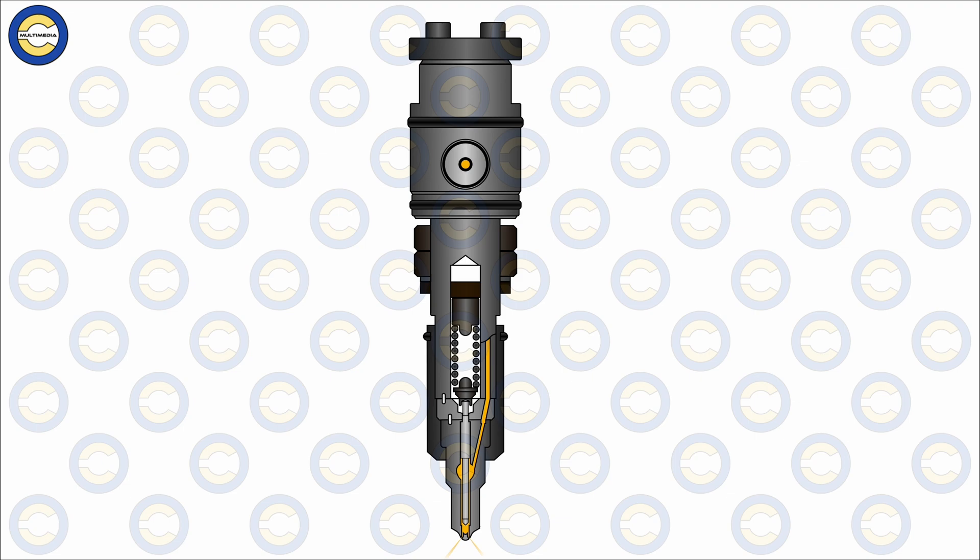Once this set pressure is exceeded by the fuel acting on the shoulder of the needle, the needle lifts. As the fuel passes through the fine holes in the nozzle it gets broken down into finite particles, forming a mist. This mist upon injection enters the combustion chamber where it undergoes complete and efficient combustion. With the simultaneous rotation of the camshaft and the motion of the fuel pump follower from peak to base, the pressure inside the fuel injector drops and reseating of the needle takes place.